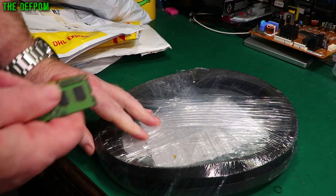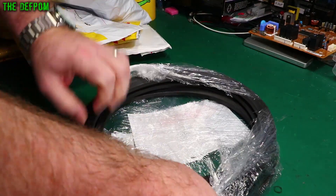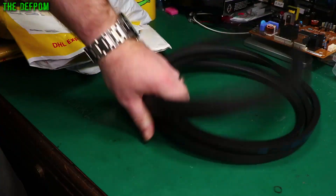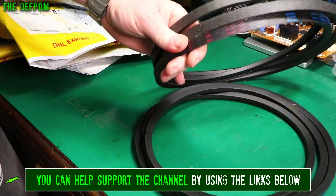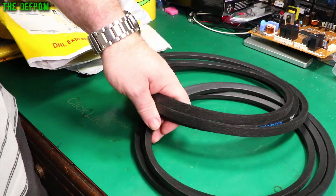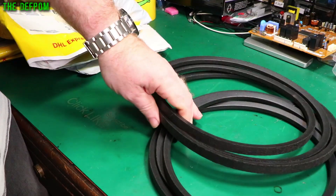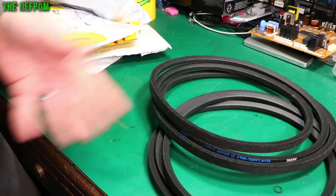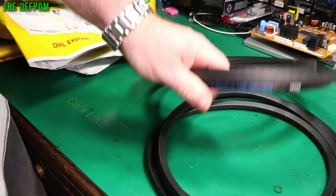I think we'll have to open it and find out. It's two belts. One of these is a 91 inch, the other one is a 92 inch A-type drive belt. My lawnmower — the other day I was cutting the grass and the belt broke. The drive belt broke so the thing got stranded, and my wife had to help me push it around so I could replace the belt.